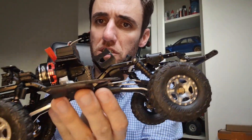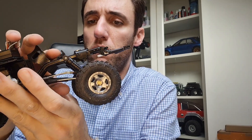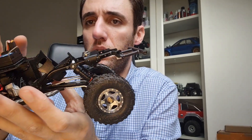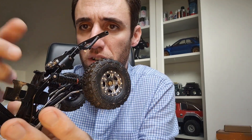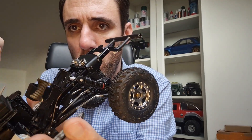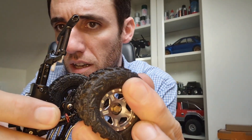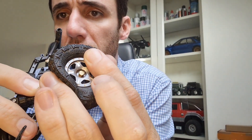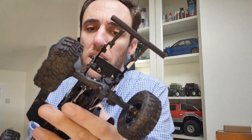Other modifications are the placement of the suspension. I've been working a lot on the suspension of this rig, basically because I didn't like how it performed and I wanted to do something better. So I took these Katana — or whatever you want to call them — one of those FMS or different models like Patriot, etc. — 1/18 scale shocks that I modified to put oil inside with silicone O-ring seal inside, following instructions from the idea of Donald's Neff, which is one of the gurus I used to follow on YouTube.